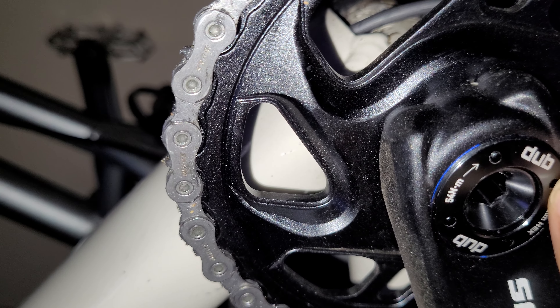Got the cranks over here. This crank, all you need is an 8mm. If this ever comes loose, you can see the lock ring tightened here just to keep things nice and tight. If this ever comes loose, you'll need those prongs — I think the tool is called prongs from Park Tool, or you can try a circlip pliers in here. If the circlip doesn't work, then you'll definitely need that Park Tool prong tool that goes in here and tightens it up. This also serves as an extractor — you put an 8mm in, you turn it, and the whole crank comes off. Just remember the back end is 135.